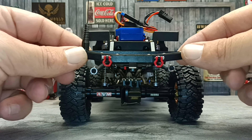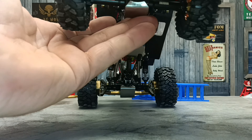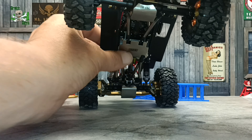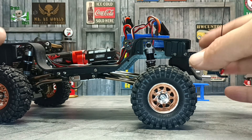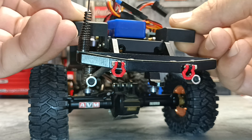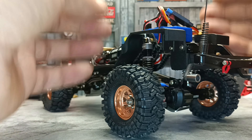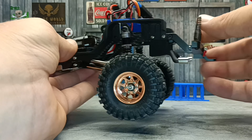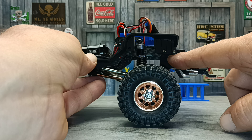As you can see that actually looks really cool from the back. Compressing the full suspension, we have no problem, so it's actually a really nice fit. The only problem I am going to have is because of fitting it behind the fenders, it's pushed it out a little bit more, so I'm going to have to take a little bit off the sides of the fenders for them to fit in between the body again.